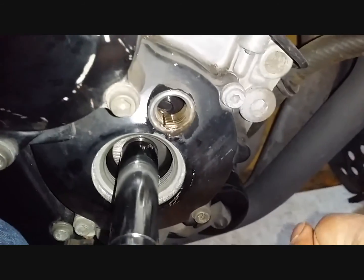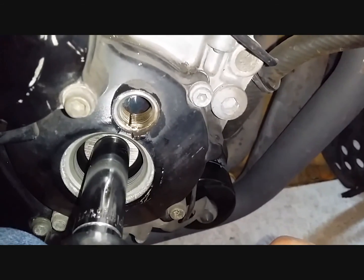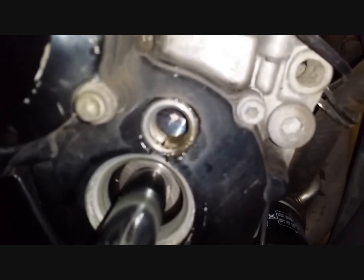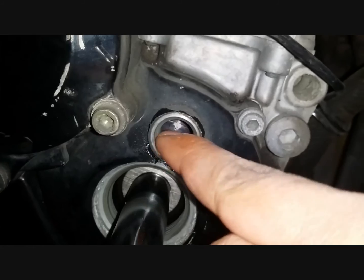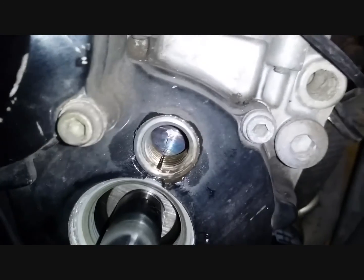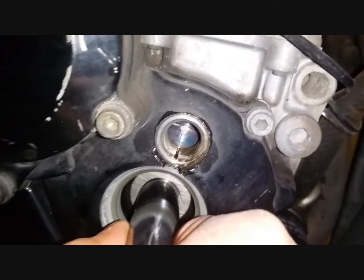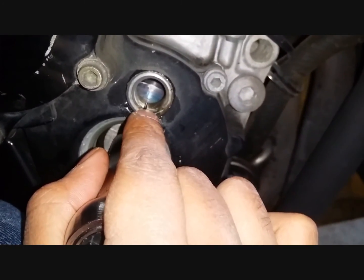What we need to do is, the first round is to align that mark. Can you see that timing mark on there? Focus. See the timing mark on the inside wheel there? There's a vertical line there. Need to align this without much parallax error with the static index mark. This one here. So let's do that.